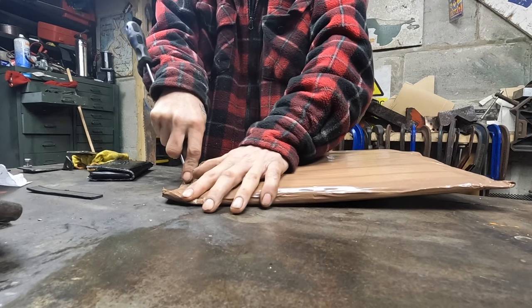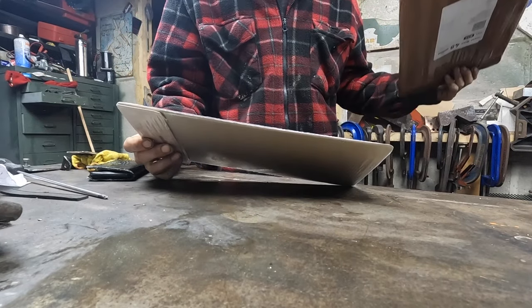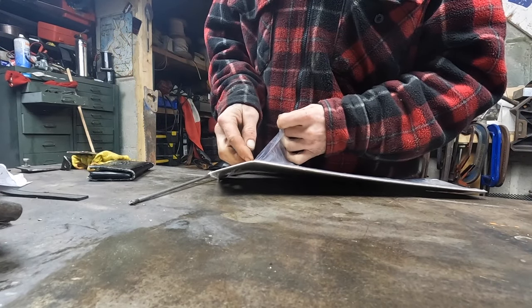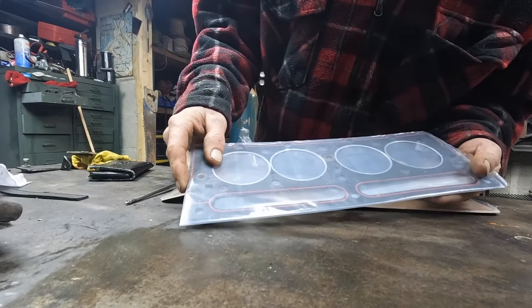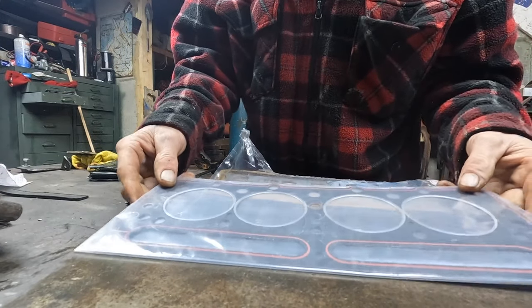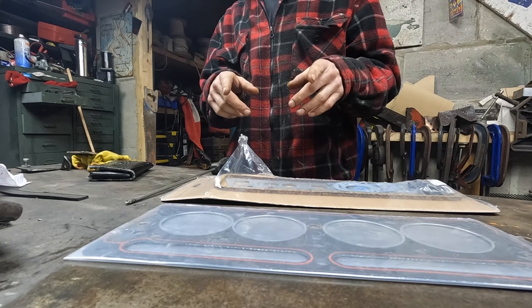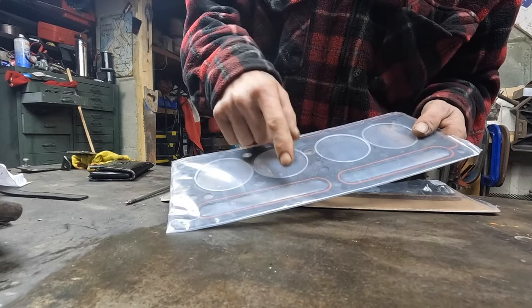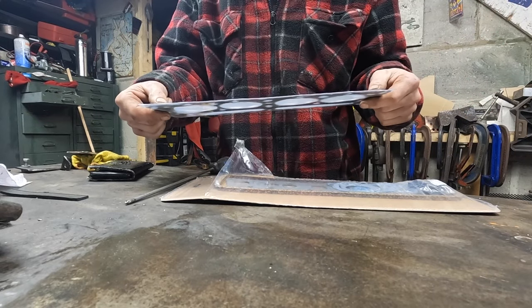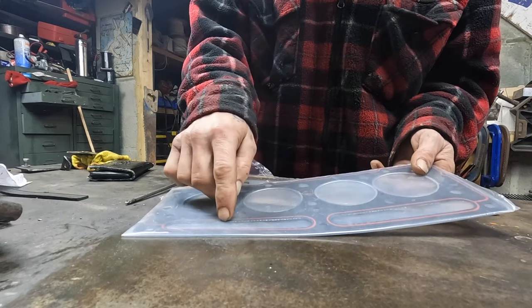Okay, so I got all the engine off for the day and the head gasket on. The head gasket set looks exactly the same as the other one. I think what the problem was, me putting it together in error, because if you look on these, they've got a little red line round. Now this is some sort of adhesive or something, I don't know what it is. But what you do is you put the head on, torque it up, and then when you fire it up to start with, you fire it up with no water in. Well, I don't know how long you have to do it for, it's enough to get these warm, and then these will seal off. Now, when I first started Ian, we were having carb issues and it was revving as you like, so it probably just blew these right out.